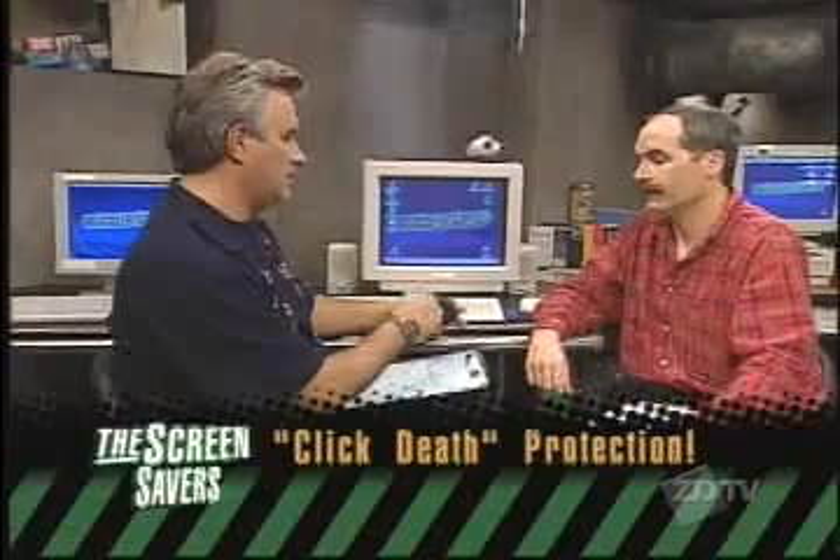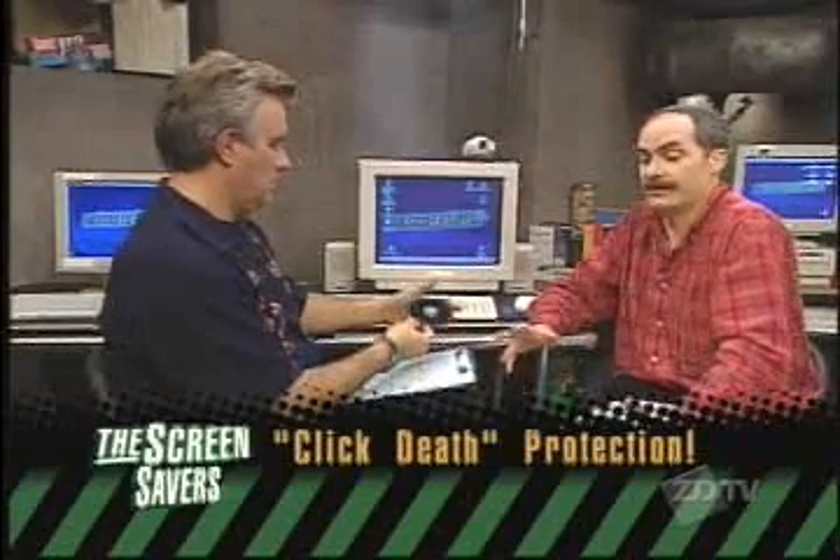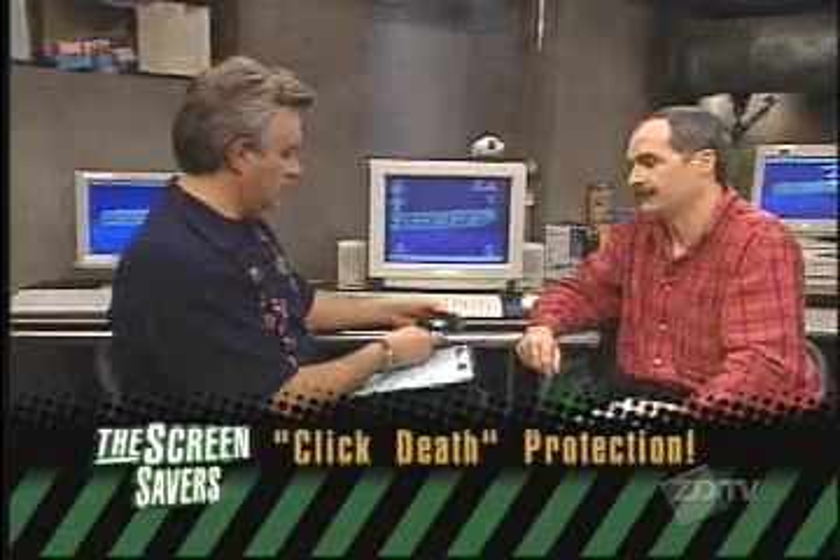One of the easiest tips: if you have a problem like this, just eject the disc and put it in again — you'll get a different alignment the next time, and it may fix it. And if that's happening to you, you know you've got a bad drive, because that should never happen. Are these drives coming out of the factory bad, or is this a wear problem? They're coming out of the factory bad. I've got reports of click of death three weeks after buying a new one. What can people do? They'll hear a seeking sound or clicking — they should immediately eject and reinsert. Then they know they have a bad drive. What you want to do is, if you can get a good insertion, copy your data off the drive. Move it onto your hard drive. Should we throw the disc away?